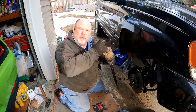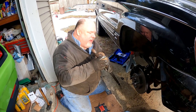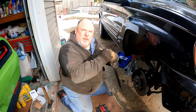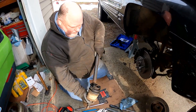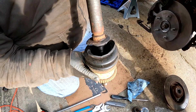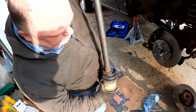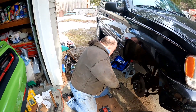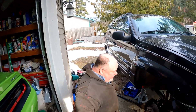These are actually driving the front wheels all the time. This little thing here turns something that turns wheels. When you went around corners you heard that noise. So he took it apart. This is supposed to be a boot, and it's supposed to be filled with grease, and it's not supposed to make those noises. It's way worn out in there, which is why the tech was like, I was trying to run some tests and drive it and got a little afraid - I didn't feel comfortable taking it on a long test drive.